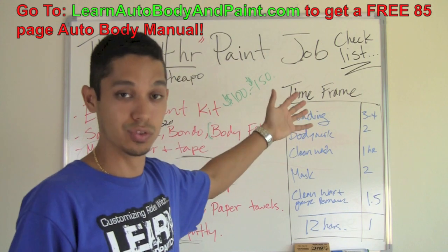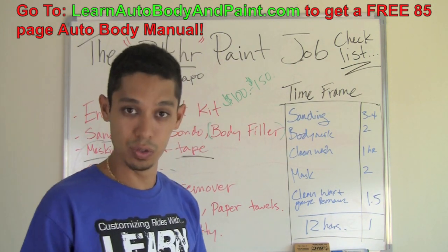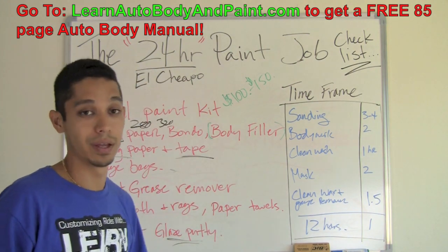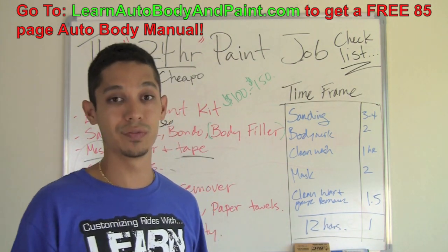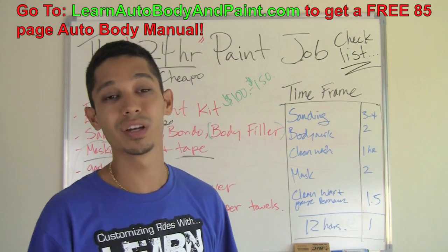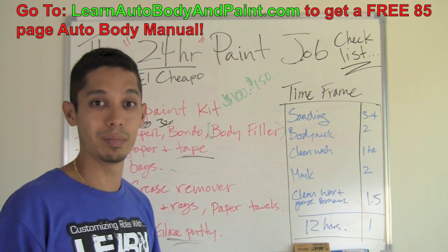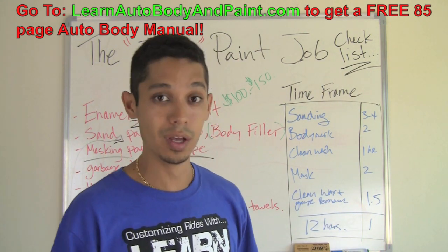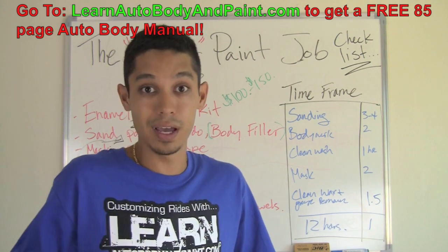This is real broken down and very doable — not made-up numbers. You can actually do it faster if you really want to. So if you have the energy and think you can do it, take the extra hour, spray it at night, and next morning take the tape off — you're done. Or if you want to break it up into a 24-hour paint job like some of my members do: do all the prep one day, and the next morning paint your car. You'll need to let it sit for about 5 to 6 hours until it's dry to the touch, then let it sit the rest of the day. I wouldn't go crazy driving it in the rain, but that's basically it — you can have it completely painted in one day if you start early.